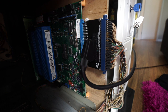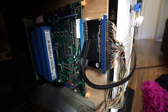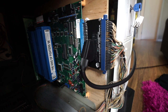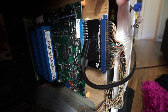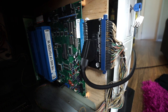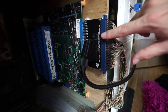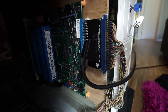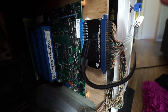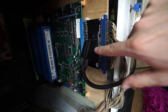Next up — this is how you can wire pretty much any Jamma arcade board. What you generally want is something like this: the Advanced SCART-to-Jamma adapter from retroelectronik.com — electronic with a K at the end. You put it on your Jamma edge — it's a SCART breakout — and what I have connected to it is just a regular SCART cable. One thing this doesn't give you is audio — it really just takes the video signal, no audio at all.